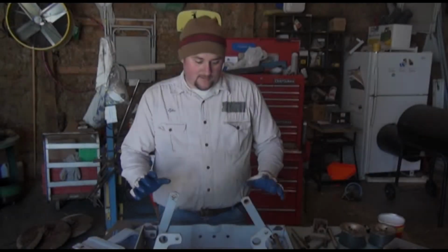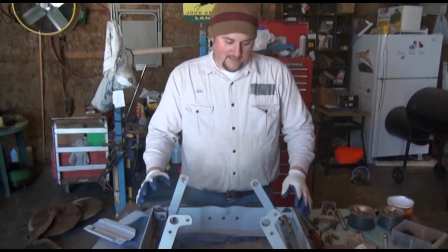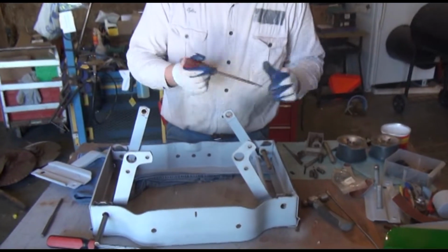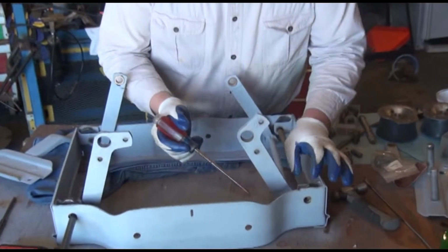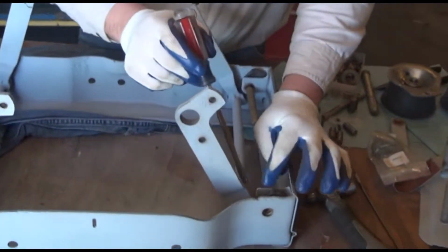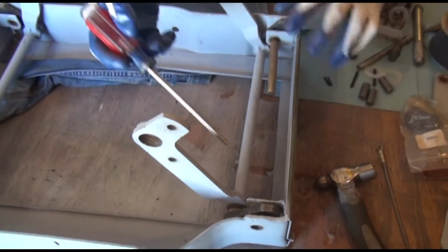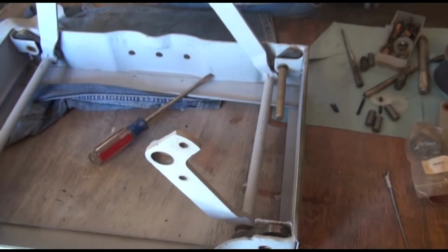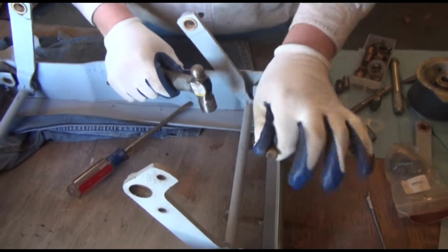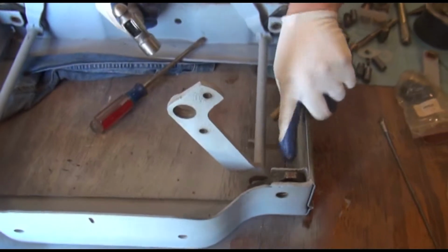Okay, so here we are having the suspension and the connectors installed into the seat frame. To do this, you kind of have to use 6 hands again, as I was saying earlier. And you may have to spring apart the little metal tab with the flange bushings just to get the connectors down in. Once you get the connectors in and started, you can take a brass drift and a hammer, and line them up until your hole's in the right spot by looking through.